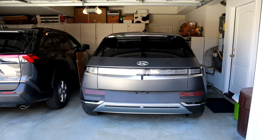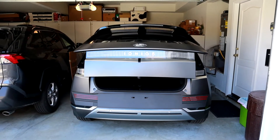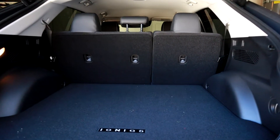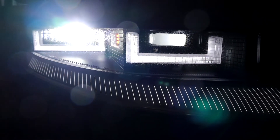Just like with AC slow charging, DC fast charging will also depend on the car you have. My dad's Ioniq 5 is exceptional — it's one of the few cars with 800-volt architecture, which means it can charge quite a bit faster on a DC fast charger than other cars. The Ioniq 5 can accept 225 kilowatts of power on a DC fast charger. Compare that to a Chevy Bolt, which can only do 50 kilowatts — it's pretty much night and day.